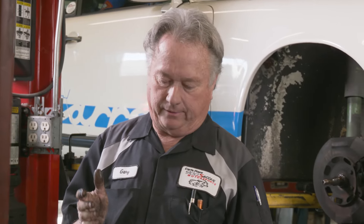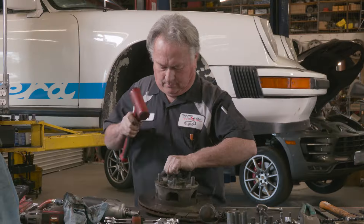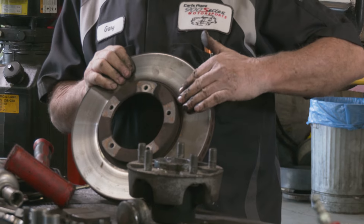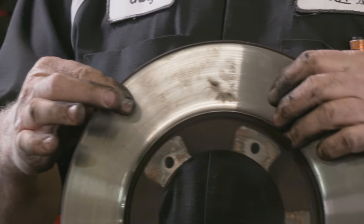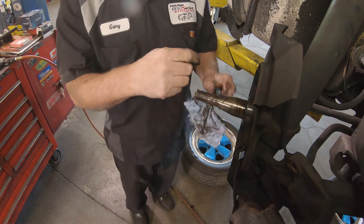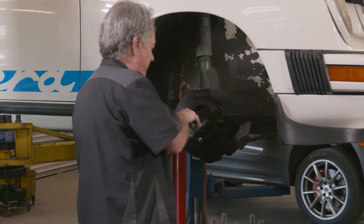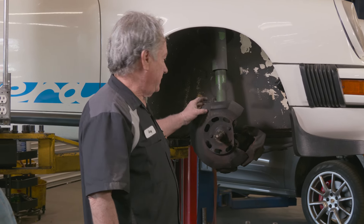He'll have his new slotted rotors and brake pads, all up to date. This is the rotor we're replacing — as the pads wear, you start to get a lip right here. When they're new, they're straight across, so that's how much is actually worn. You can mic them for minimum thickness, but we're not concerned with that since we're putting slotted ones on. I want to check the seal surface where the seal actually rides — it's in good shape. I usually take the splash shield off and blast it, get it cleaned back up.